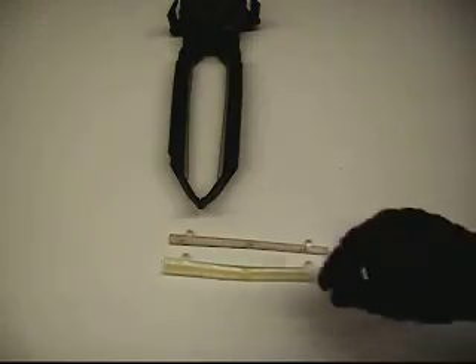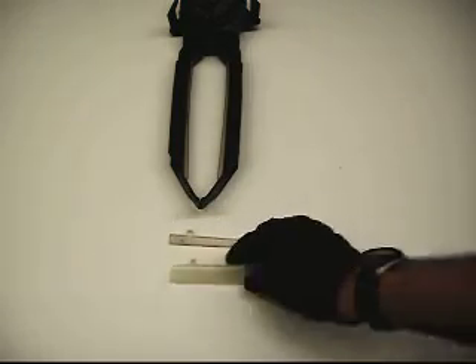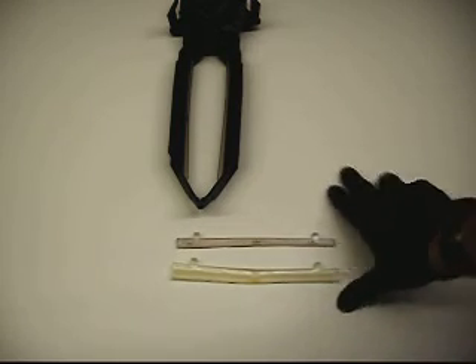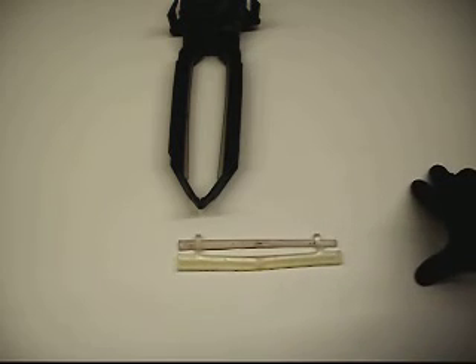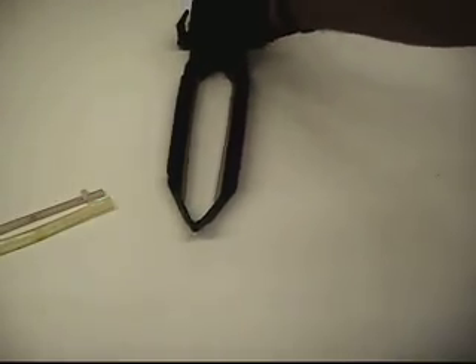Now the oversized dampers — yes, they do help out, but in the long term they do more damage than they save in the short term for picking up pins. If your pin setters are dropping pins, I'd recommend you dedicate a little time to mechanics actually going back there and repairing them. Don't just let anybody slam the dampers in there and say it's a fix.